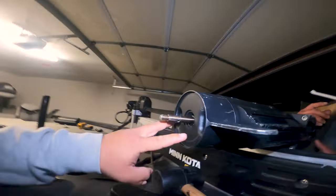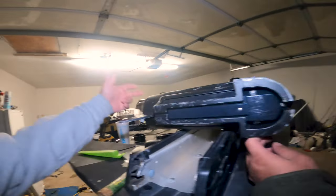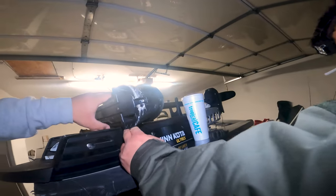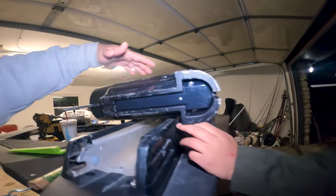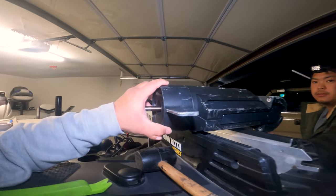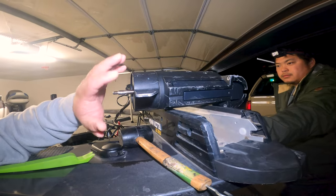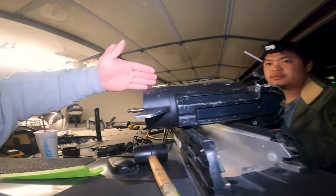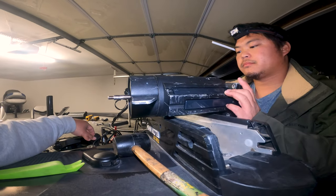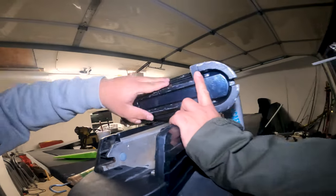So basically, these two bolts go all the way through and hold onto the nose cone. That's why when you loosen those two bolts, you can move this piece and you can move this Skeg. So what you want to do is put it as close as you can. But some people be telling me that when you put it on, like, speed 3, as you turn this Skeg, you'll hear the engine go up in RPM and lower in RPM. So you want to find the sweet spot, the highest RPM that you can get. That basically means that all the bushings and everything are aligned properly. So that's probably why ours isn't acting right. We're going to do that too. But for the most part, we're just going to hold it as straight as we can first, because as you can see, this unit took a beating.